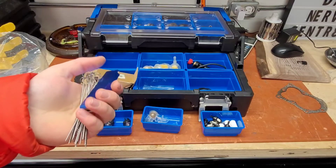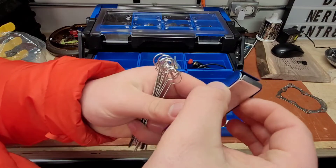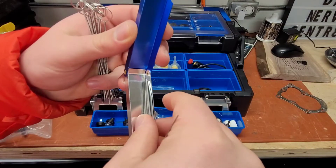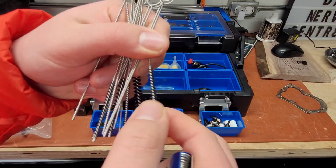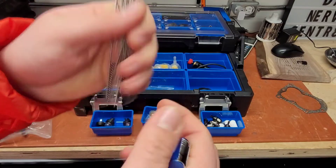To end off our video, here are just a couple of specialty tools that I have for cleaning carburetors. These are just torch tip cleaners for welding torches. These are pretty good to get into little orifices and stuff in carburetors. And these brushes are also quite nice — they're soft but also stiff, so they clean the holes out really good.